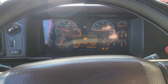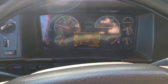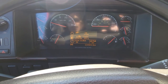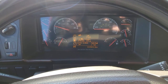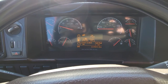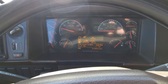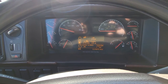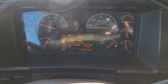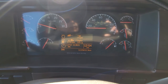Pump your brake. Go at 80 psi. Watch your needles. Compressor starts building air. If compressor starts building air at 80 or under, it's minor. Then press your brake and hold. Needle went down a little bit. We have to wait until compressor resets at 90 psi. Okay, compressor reset 90 psi. If compressor does not maintain or reach 90 psi, it's a major defect.